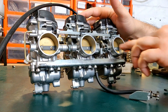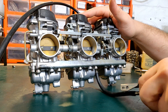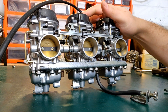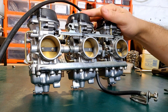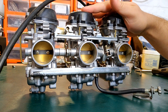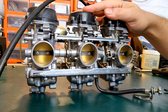Once you've got all of them set up, don't forget - if they are too tight, open the idle adjustment a little bit so when you actually start the bike it doesn't choke and die, because there is absolutely no gap there. But the gap will be even across all three of them now. That's pretty much it - that's how you sync carbs using feeler gauges. Let me know what you think if you're going to try it, let me know how you got on. It should work for you just fine and I'm looking forward to hearing from you. Thank you, guys.